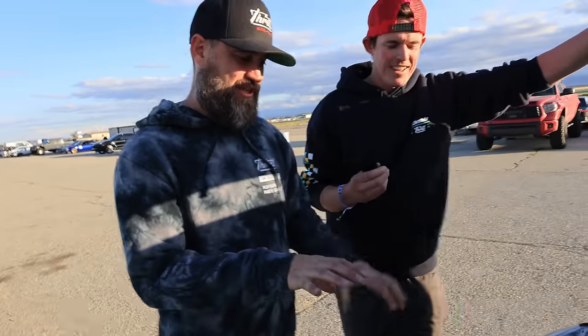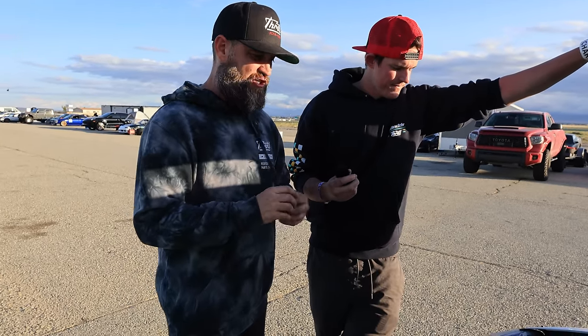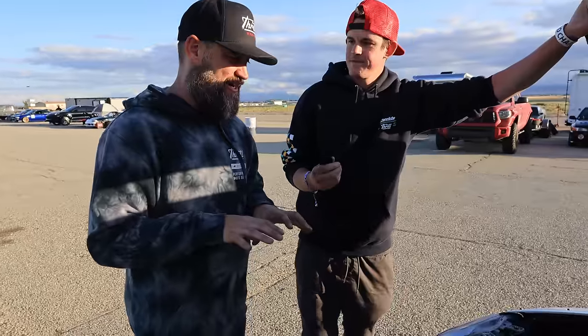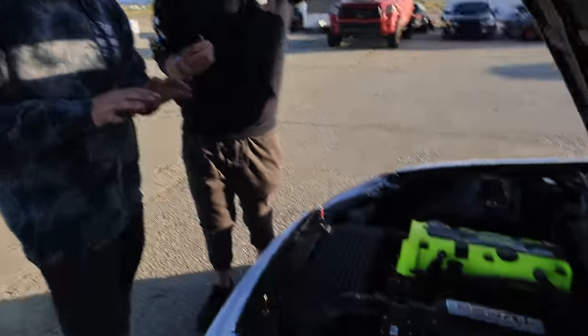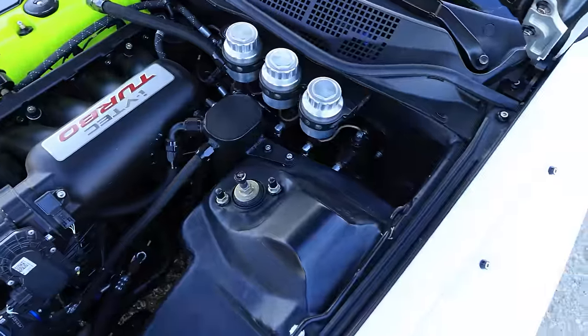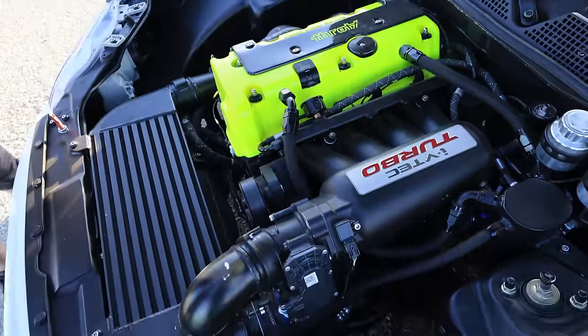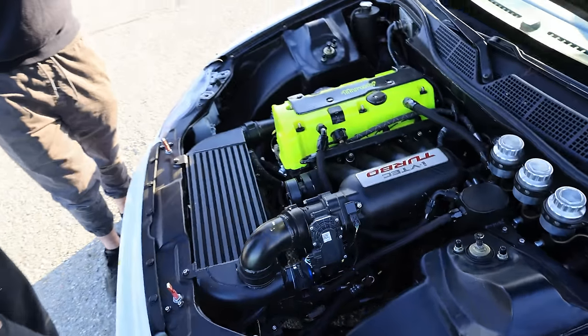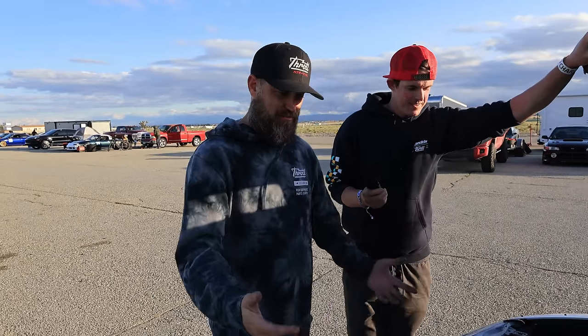Because we did use a lot of the stock Honda parts in the front suspension. We just modified them or added what we needed to those bits. So geometry-wise, it's pretty much a front-wheel drive front suspension geometry. Control arms, everything's all the same. The only thing we really changed was the compliance arms, from reaching towards the back to towards the front by using tension rods. And we used the stock uprights, the stock upper A-arms and everything. So in theory, A-arm suspension should work great, and it does work good.